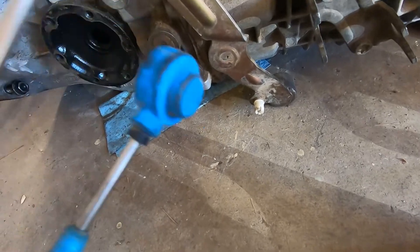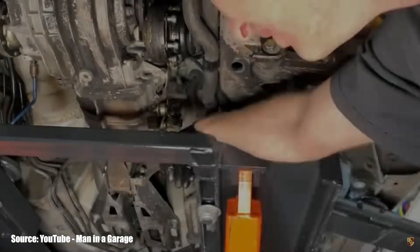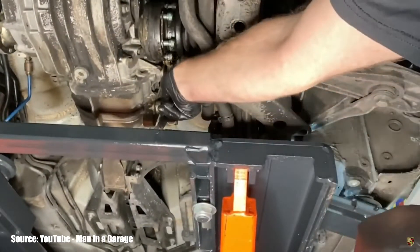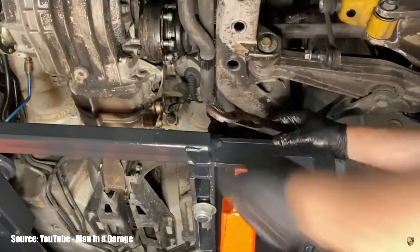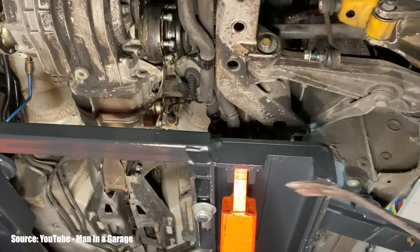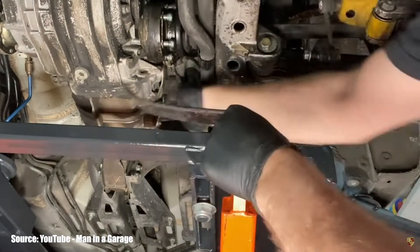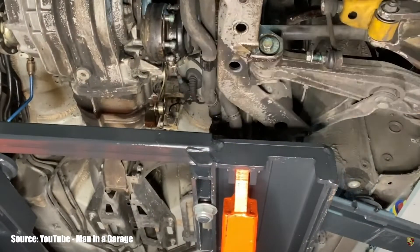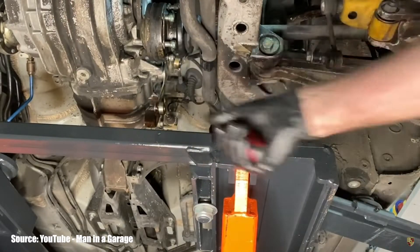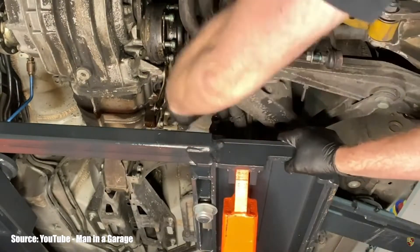I used his videos to get the engine out of this car. Next was the shift cables. It was kind of awkward — you can see I dropped one off there after squeezing it with the channel locks. I don't know if there is a better way, but the channel locks did work to get the clips off one end. Once you get the clips off that allow the cables to come free of the chassis, you need to undo the very end of the cables that go onto these little metal balls. I tried the crowbar and that didn't really work, but in the end, just a chunky flat head screwdriver was all you needed to get those gear shifter cables off.